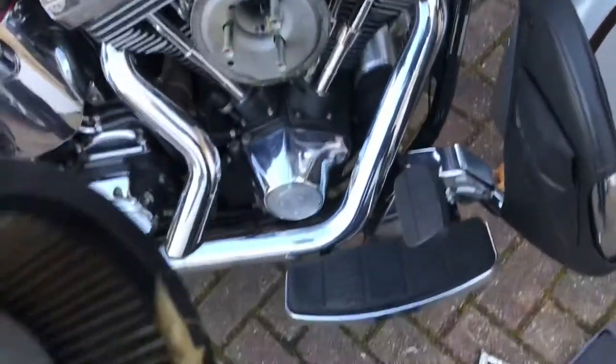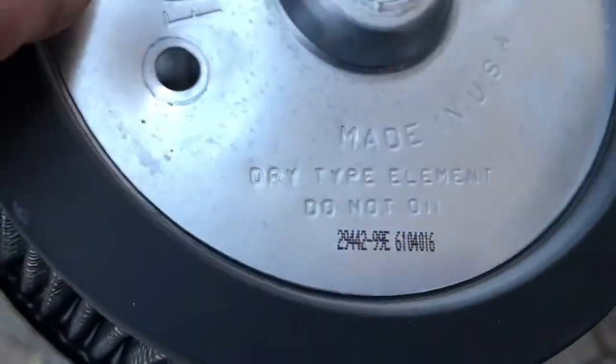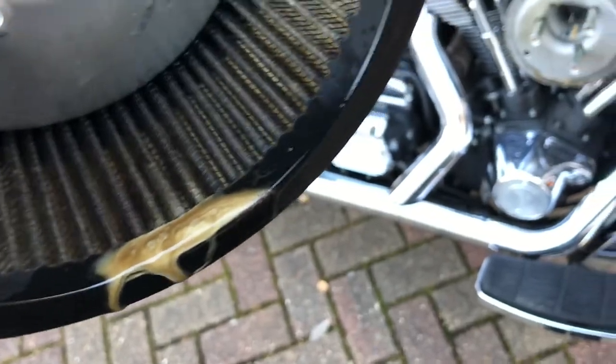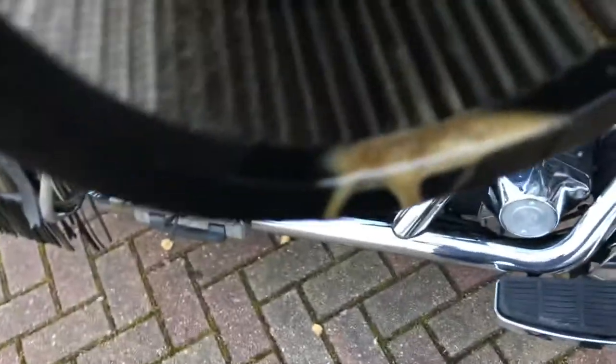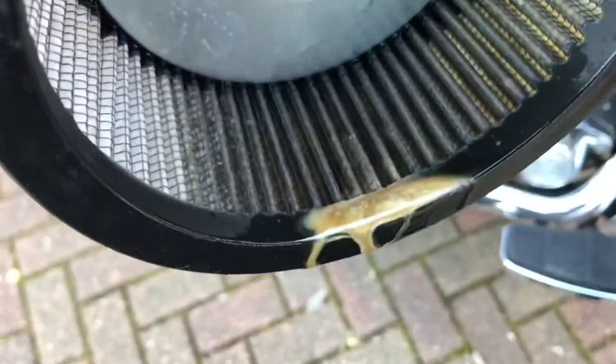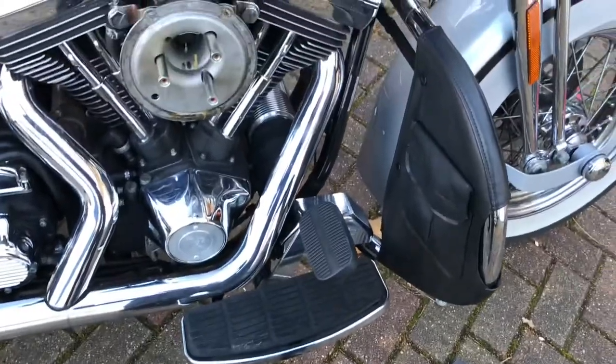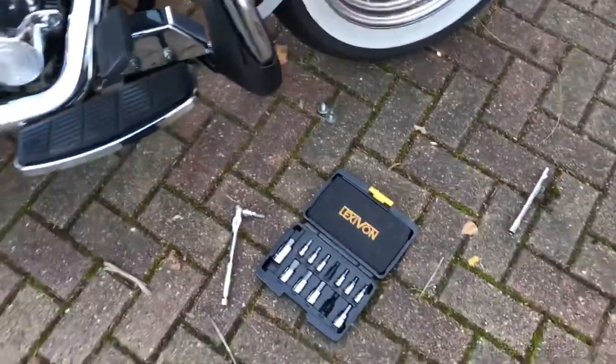So there's the filter off. I notice it says 'dry type, do not oil,' and inside there's a rather murky looking puddle. After about 1,500 to 2,000 miles, the whole of the bottom third of it is damp. So obviously the breathers are working — I'm not sure this is a good thing because once that all gets clogged up, it'll be a problem. I'll get a cloth and give that a wipe off.